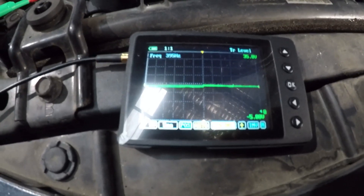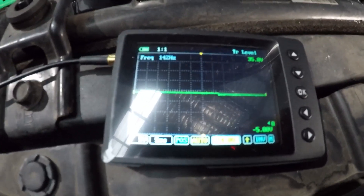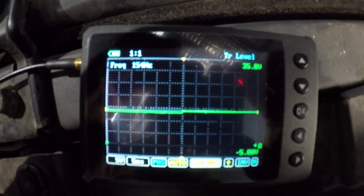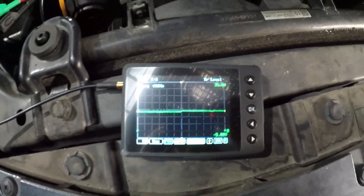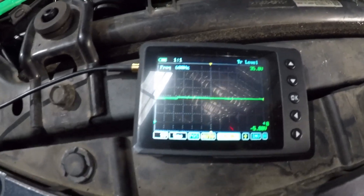We're back connected with the U-scope, car has been running for a few minutes, and we still have about 14 volts - cursor is at the 14-volt mark and it's been running for ages. We know there is no issue going forward. Let's go back inside the car and check the data PID again just to make sure we still have good current.